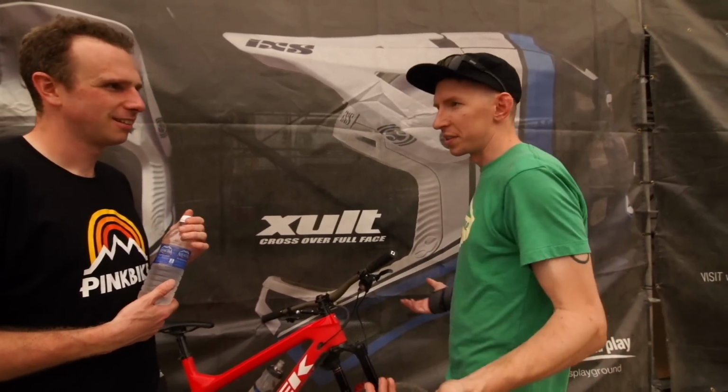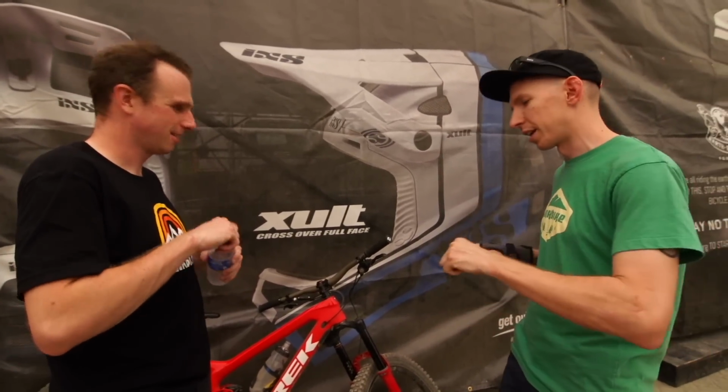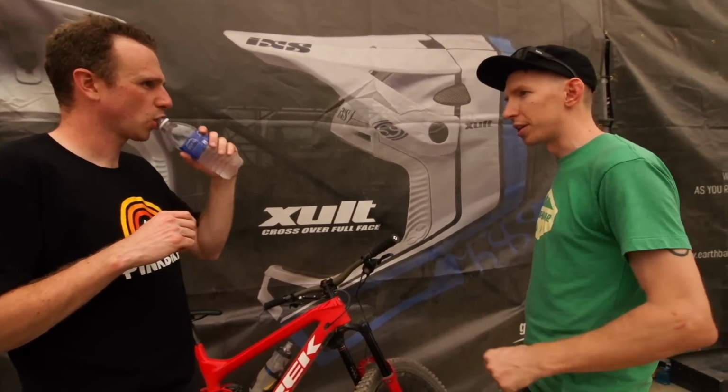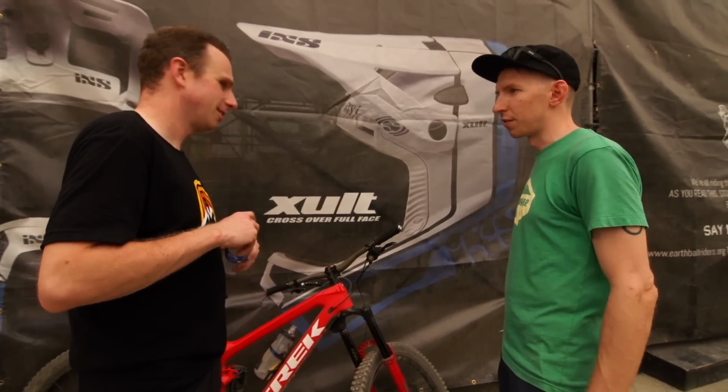Yeah. We could say it doesn't, but you could just put in one more click and see what that feels like. That might just be that little bit of support you're looking for. It's not really bringing the front up, but when you're hitting the slower stuff, it's not going to dive as much. So you can even try that. I would almost do that. I might try just 4 clicks of low speed.